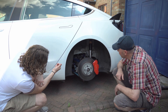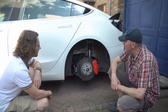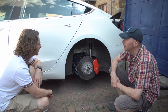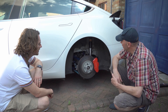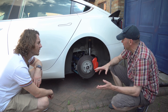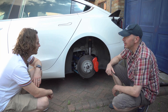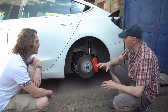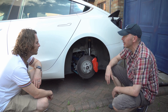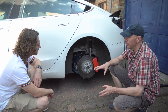You can get underneath or over the top and just flick to the desired number — all the size and job done. KW give you their recommended settings for track work, rebound and compression front and rear different. But normally I drive the thing for a few weeks, make an adjustment, drive it again for a few weeks, make another adjustment, and do that until I've dialed in front and rear how I like it — getting the balance right between comfort and compromise.